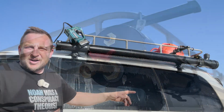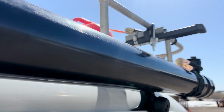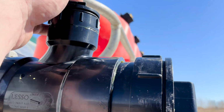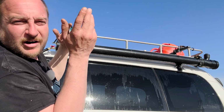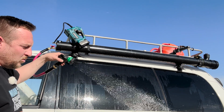But yeah, I did this very cheaply. This is a how-to video, how I did it. All it is, is a couple bulkhead fittings, a hose fitting, and some standard hardware store ABS pipe. Now, when the sun shines on it, it heats up the water a lot. And then whenever I want, you can have a shower, wash your dishes for the hashtag Vanlife, or just a road trip. So stay tuned.